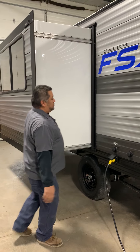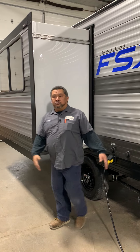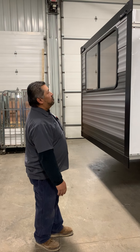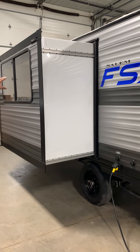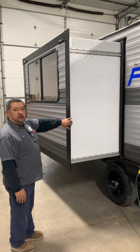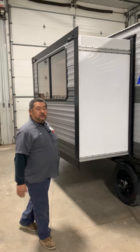For the slide, I usually put my back against it and that'll give you enough room to run your slide out, so once you get on the site that's a quick way to reference positioning. You're going to have to check the tops of your slide before you run them in. On these slides, you don't want to block them up — you want to run this thing at least once a month. When you are camping, bring it in and make it work; otherwise when you're out there it won't work.